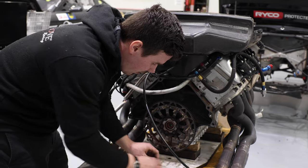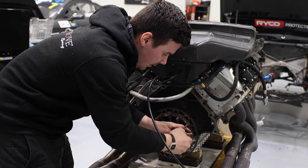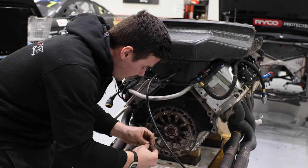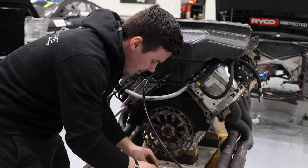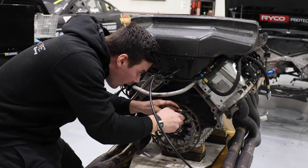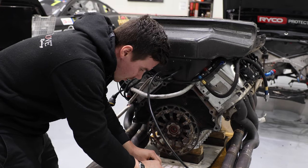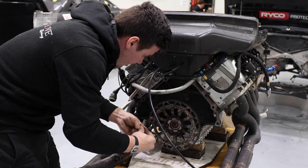It will go back with the engine to the engine shop and they'll just check all the nuts are still secure. These are like jet nuts — they're technically not circular, they're almost kinked and they nip up on the thread, just like an anti-vibration sort of device. And hopefully it stops our clutch flying off as we drive around the racetrack, in theory.